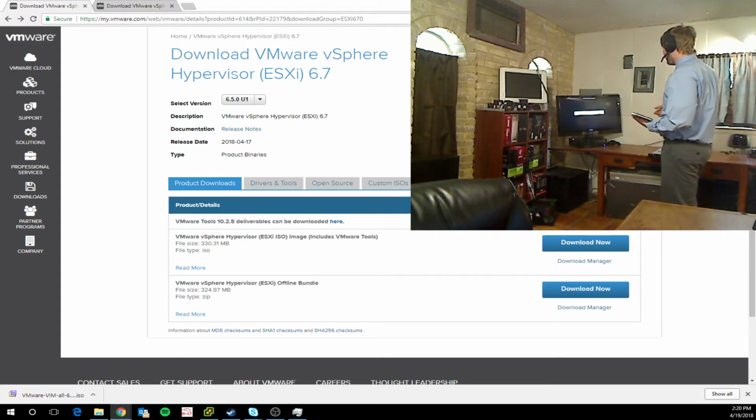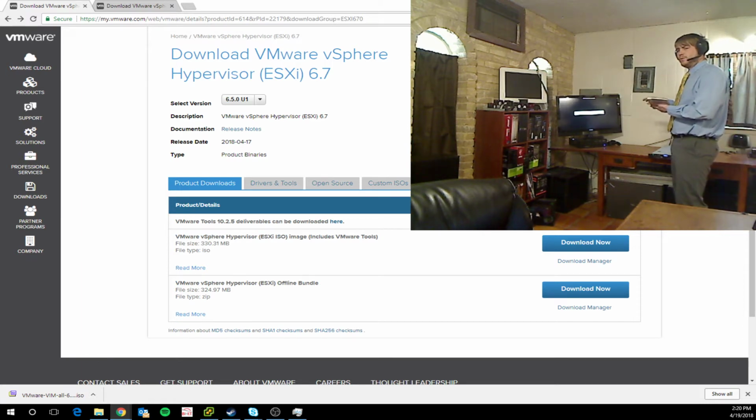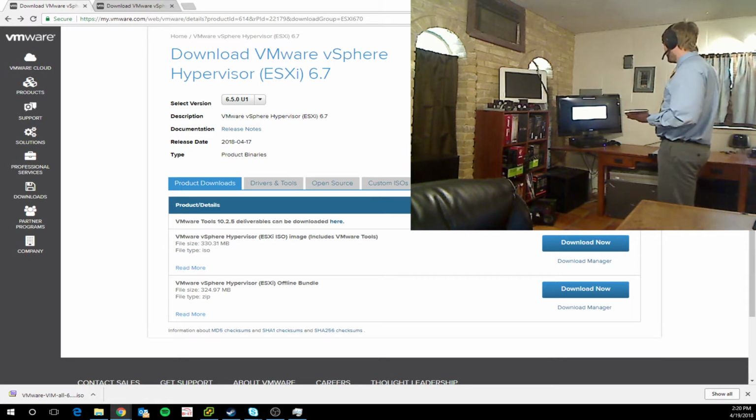Now, as I was saying before, that whole time what it was doing there is it was loading. It was actually loading the whole ESXi installer into the RAM for the device, so that way we can then install onto the USB. So just as we selected the USB from the beginning in the BIOS boot menu to boot up off of it, loaded everything in RAM, we can now choose that same USB to install on. Which is kind of pretty interesting.